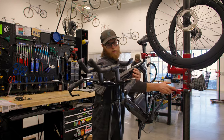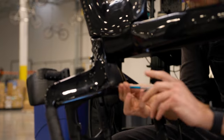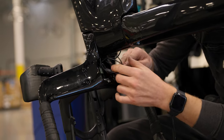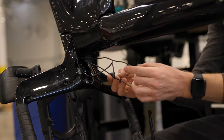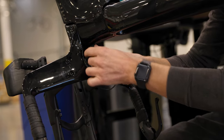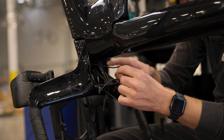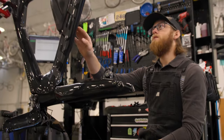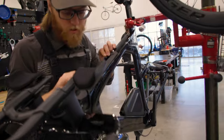I've got to bring the bike up and uncover a few things. That uncovers what I suspected - these are older 11-speed components with 11-speed wires. What's strange is I only have two cables coming in and one going out. I should have four, since I have four components up here, and I would expect somewhere inside the bike to have an adapter that adapts these older wires to work with the new 12-speed stuff. I'm going to bring the bike back up and start removing all the other covers I can find.